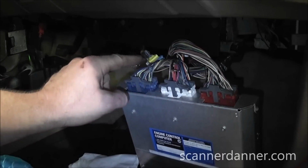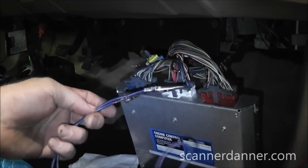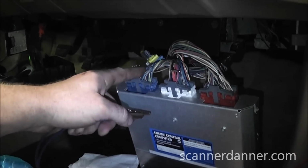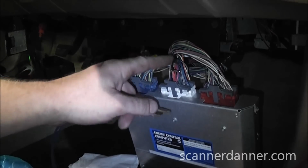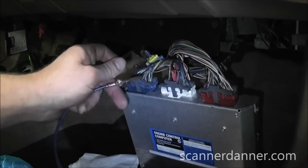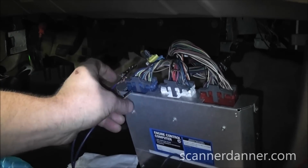with a good reference. So, jumper wire, I'm just going to take, and you know, you could probably do this permanently if you wanted to. You could take this gray wire here, which is a reference, take the insulation off of it a little bit, same thing here, run a jumper between, solder it, tape it up. This is inside the car. I really wouldn't have a problem with that fix. If this guy wants to do that, that's going to be up to him.